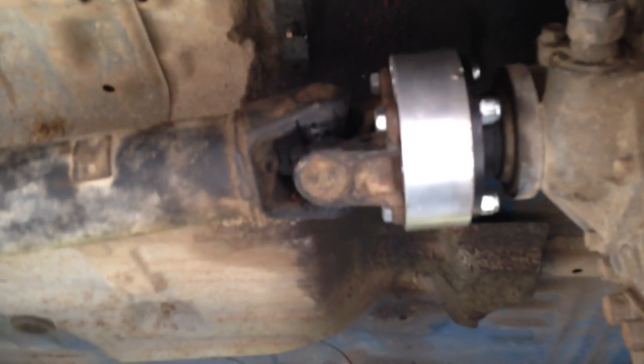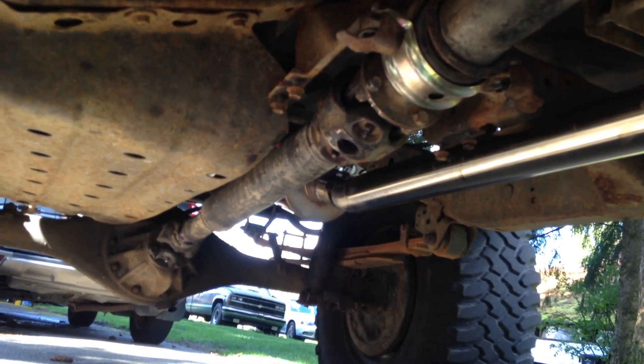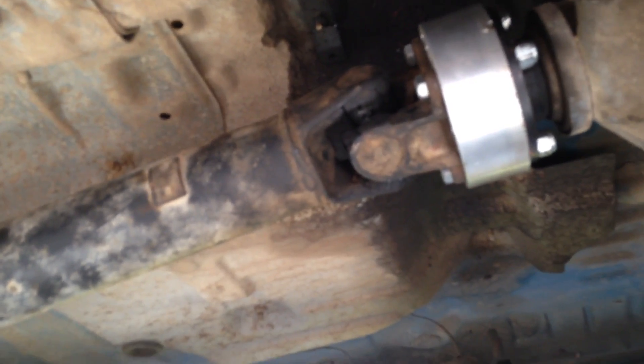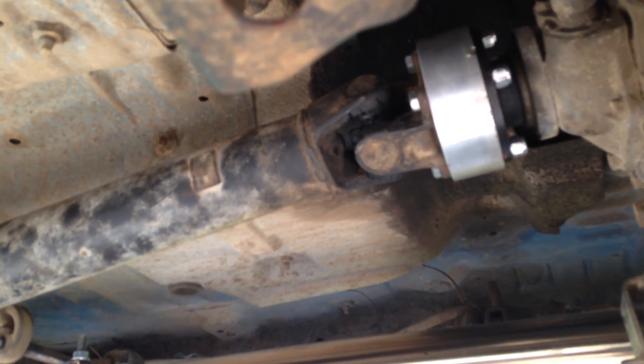For the driveline, I used a one and a half inch spacer — actually I'm going to be putting a one and a quarter inch spacer in there instead. The driveshaft itself is an '89 to '95 3-litre automatic pickup driveshaft, so it's just a little bit shorter, but it actually allows it to be fully bolted in with no real modifications. I might go to a one-piece eventually, but this whole combo was roughly $100 including that spacer.